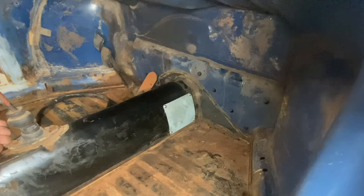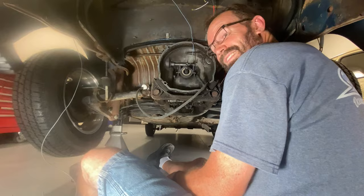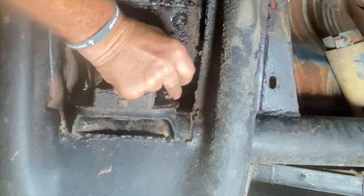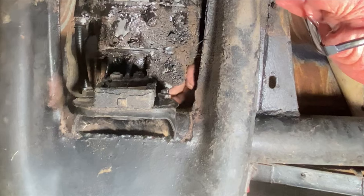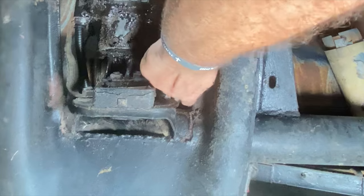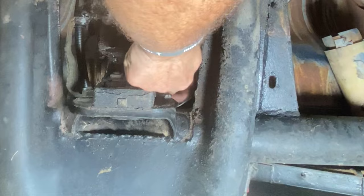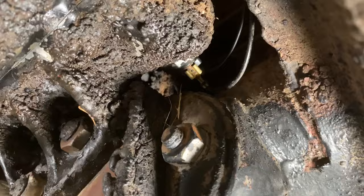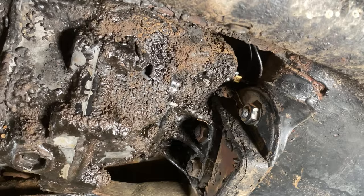Now we've got some work to do on the transmission area. Reverse light wires aren't easy to hook up even when things are clean — they're worse when things are dirty. I've got to get this guy off from up there. Got him. It doesn't matter which wire goes to which terminal — just an open and close switch. That's half of it. Got it — that's one of two. Half the battle. This one I can see, but it doesn't mean it's going to be easier. There we go — got them both, top and bottom. Not a fun job, especially with all this grease and grime. But that's done.